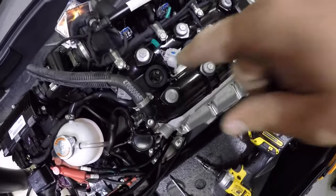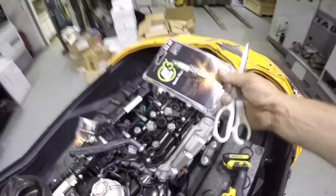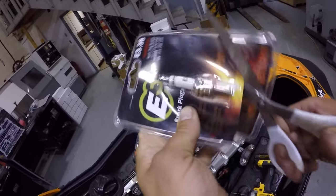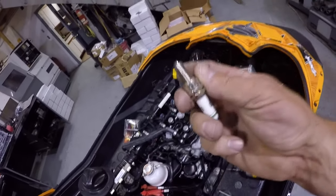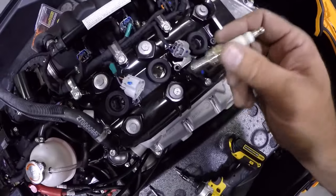So now it's time to get a spark plug wrench with a long extension and get in there and take that out. I'm going to open up my other plugs, and that way I can match my socket to this plug. It should be the same. They're really weird looking plugs. I've had a lot of dirt bikes over the years and snow machines, and I've never seen a motor take such a small thread for a plug. I don't even know what thread size that is. M10, I guess. Yeah, it's pretty tiny.